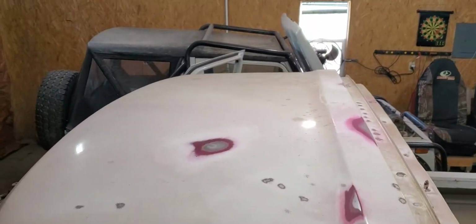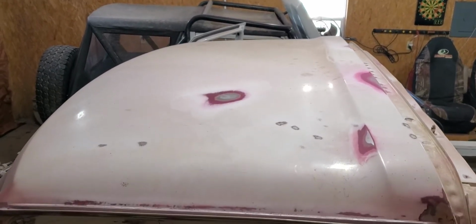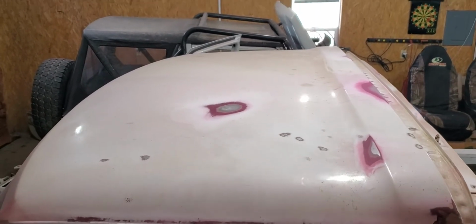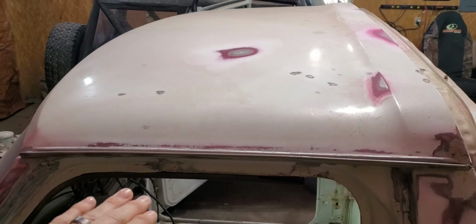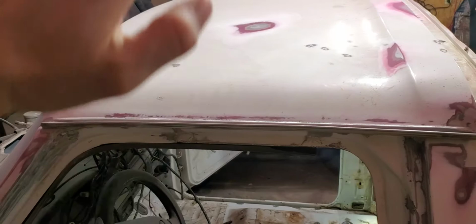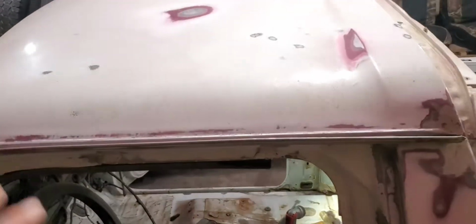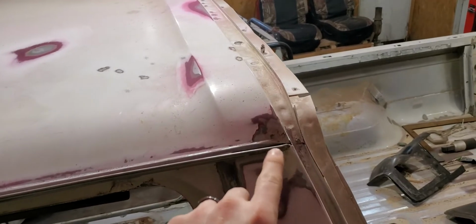On the roof here, I got a few little spots that I sandblasted down and ground out because they were little tiny rust spots. Even though they were stone chips and so minute, I wanted them out, because when I go to bedline this whole entire thing, which is what I plan on doing, I plan on coming down here to where my channel is, right where the channel is, and then up, because I want to hit the underside of that drip edge rail and the top side. As you can see, it holds a lot of stuff under there, and I want that filled in. With the bed liner it'll be watertight, completely sealed, and I won't get this popping and rot like I did before.